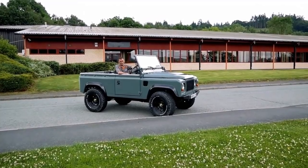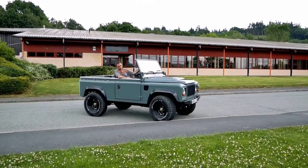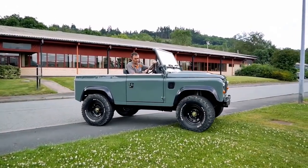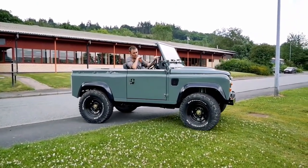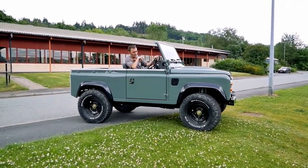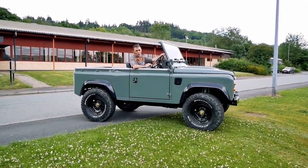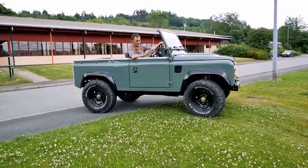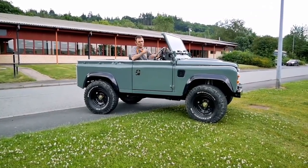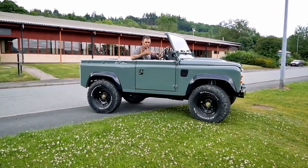But it's no good when you're off-road - all that power is just too much. Having a really aggressive throttle response is no good when you've got hardly any grip in mud and gravel. Even though this vehicle has traction control and three LSDs, it'll struggle to cope with 450 horsepower when you floor it. Also, the regen in on-road mode is okay when slowing to a roundabout on tarmac, but when you're coming down a steep hill and want to manage the descent, it's not really going to be man enough for the job.